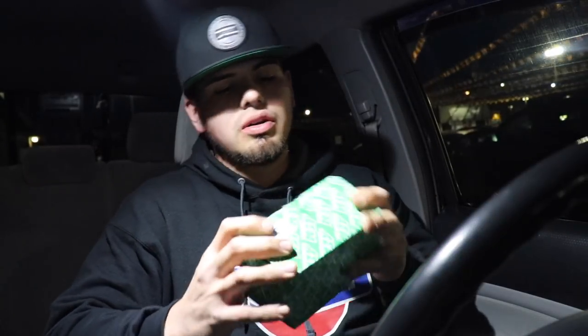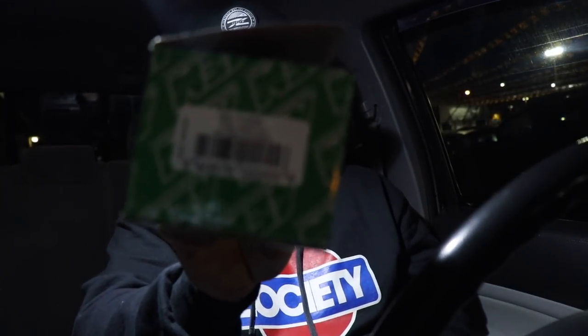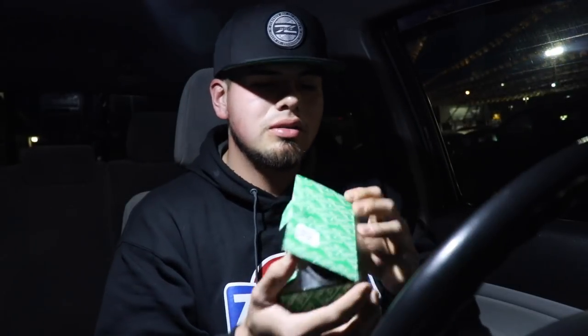E85 demands a lot of fuel — it burns faster, which makes the fuel pump work harder and faster. That's why I'm upgrading my fuel pump. I bought this one off my boy Sergio, 08 Nismo — I'll ask him where he ordered it from if you guys want to know. But I bought this fuel pump from him; again it's a larger fuel pump.